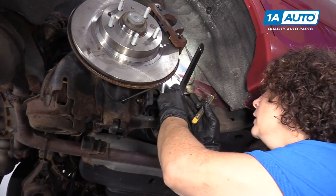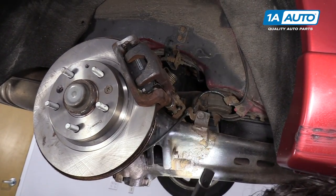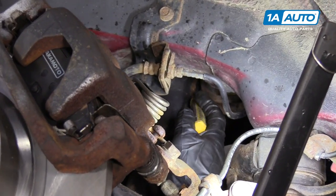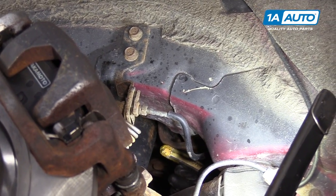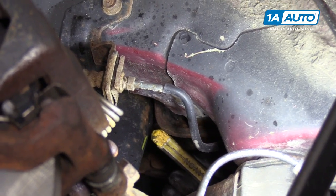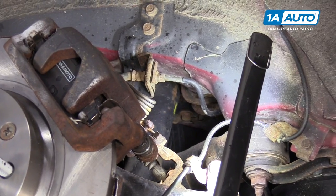When doing the rear shocks on this particular model, the manufacturer directions tell you to mark the degrees angle of the shock. The bracket — the top bracket comes out with the shock at the same time. I'm just going to mark this bracket and where it mounts up on the top of the shock shroud, to give myself a general idea of the angle. Then we're going to go up in there and loosen the three bolts that mount up to the body frame.